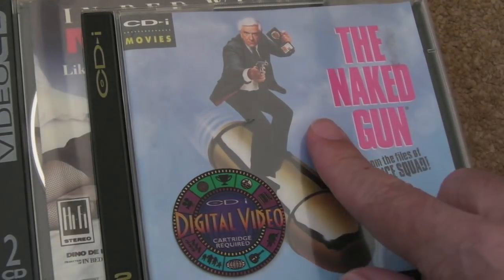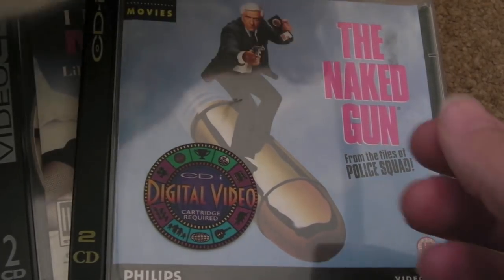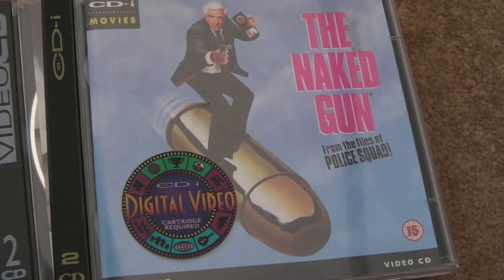So yeah, coming back to what I said before, these are MPEG 1, DVD used MPEG 2 compression. And the drives are 150k, single speed, as I mentioned earlier, 150k per second. Now if you compare that to modern Blu-ray drives, single speed is 4.5 megabytes per second, not 150k, 4.5 megabytes. And if you get one of the top of the range Blu-ray players, I don't know what speed they are, 24 speed or something, 72 megabytes per second. So there's a huge difference there, and obviously there needs to be because there's an awful lot more data. You've got much higher resolution, but the compression, as things moved on, moving up from MPEG onto MPEG 2 and the technologies that are used for Blu-ray and MKV files and things like that, were much higher compression and a much better picture quality as well.